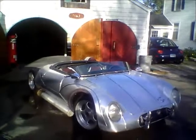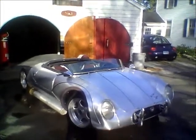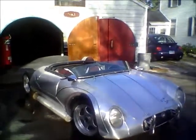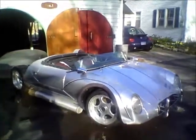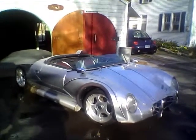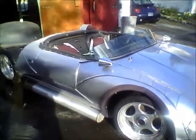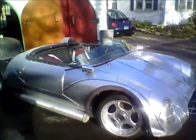It's kind of an illusion because the car is not aluminum — I put aluminum panels over fiberglass bucks, then cut out fiberglass from underneath to save weight. I shaped these panels over all of the fiberglass by hand, making sure I never had to make a compound curve, which is the main problem anyone who does metalwork knows about.